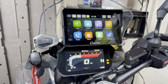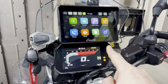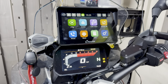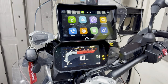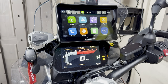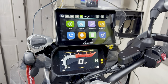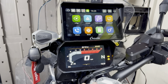I even did what GSD321 said in his review, which was basically don't pair the headset to this — pair the headset directly to your phone as you normally would. I had two issues with that. Number one, because CarPlay wants to shove the audio over to this by default, I couldn't always get the audio to come out of my headset. But even if I could get the audio to come out of my headset, I could hear the audio playback perfectly, but I still had the issue that when speaking, people couldn't hear me — and it's all fine when it's just my headset and my phone, or when I pair everything via the bike.